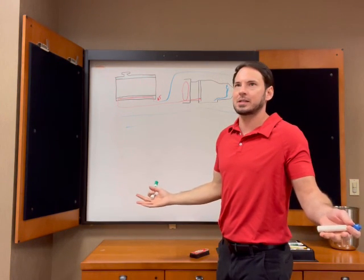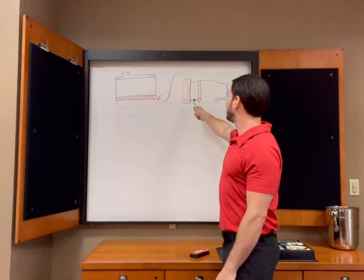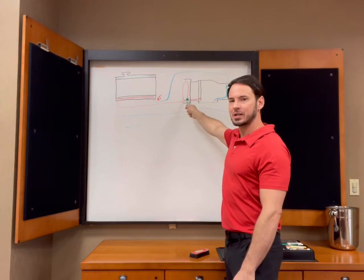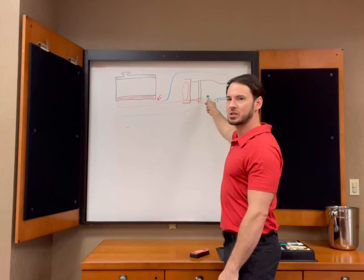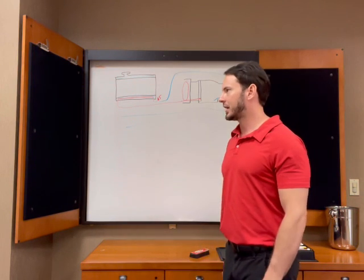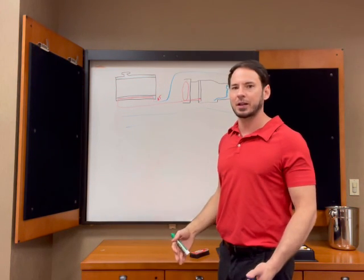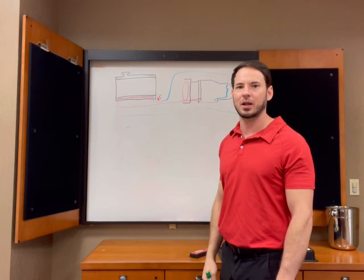Yeah, the SVX is a heavy car. What are they, 3,500 pounds for the fully loaded one? You're never going to really stress this transmission. And keep in mind how the SVX drives. This transmission's trying to get into fourth gear like it's its job. You know how the SVX drives? Even if you're driving it fairly hard, by the time you get to 50, the car's in fourth gear and it's got the torque converter locked up.